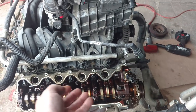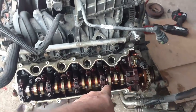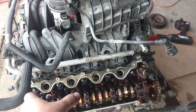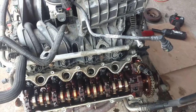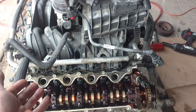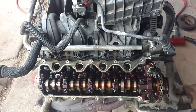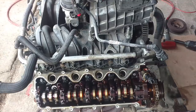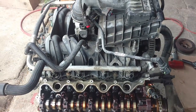In order to get this back to what I would consider good condition — it's a double-edged sword. I could break off some of this stuff in here and vacuum it out, but any parts of the oil chunks that I break loose and don't get — you know where they're going to end up — in the pickup tube. It's not like I can just let it run and then take the oil pan off to clean everything out. So I have to do it in multiple steps. I will be using engine detergent and internal engine cleaner in this engine for the rest of its life. I've got to be careful what detergent I use because I'm using synthetic oil and I don't want to break down the oil and cause more trouble.